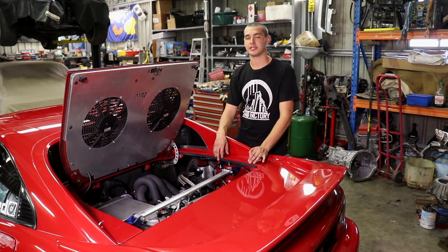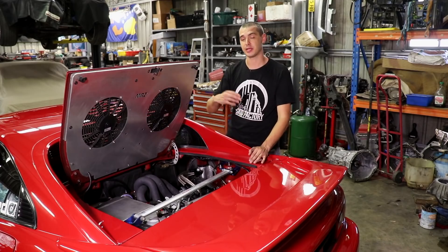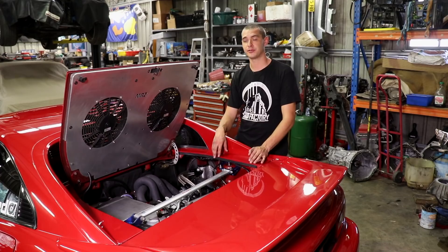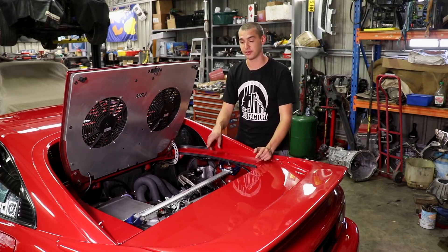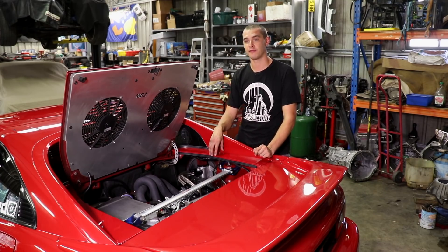In the process of replacing the engine, we also replaced the gearbox. It's an E153, but we replaced it with an LSD variant. It's got upgraded CV joints with the standard drive shafts. Everything's pretty strong — Matthew's given this thing a few launchers and it's alright. There are a lot of these making some pretty stout power on these standard items and they work very well.